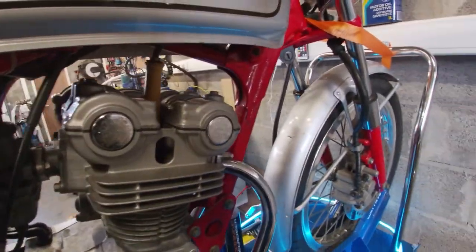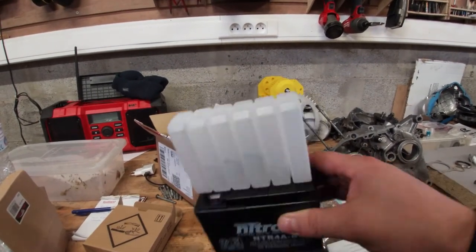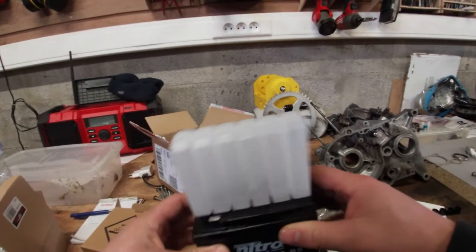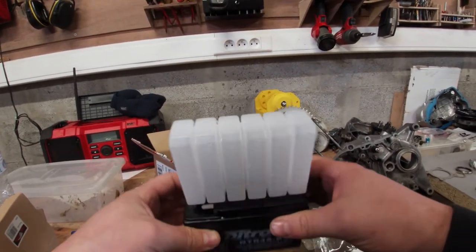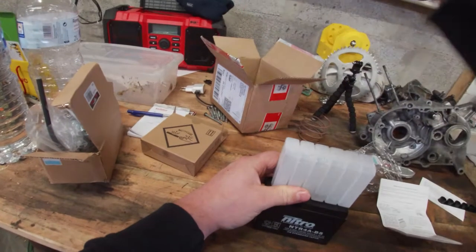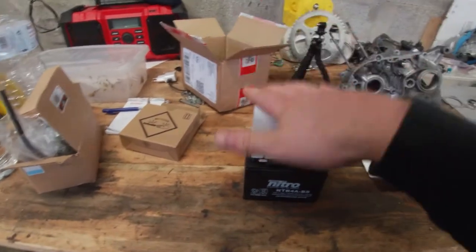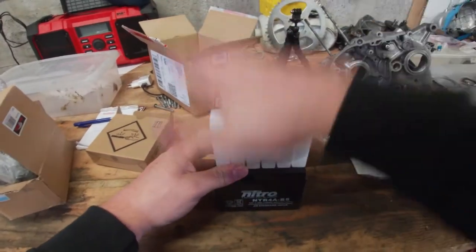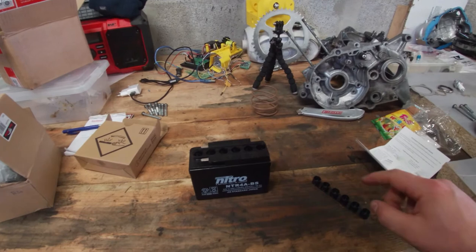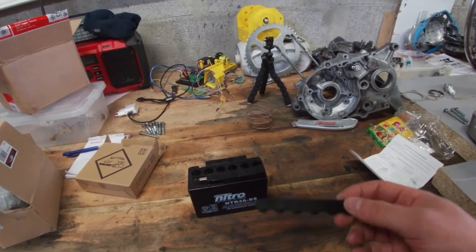Let's check back on the battery pack. I'm trying to speed up the process by shaking it a bit so the air bubbles get free. The outside ones are already empty. Just shake it lightly, don't go all berserk. The instruction manual says to tap the back of the acid pack — the acid pack is empty. They say to leave it for 10 minutes, which I don't want to do but I'm going to.